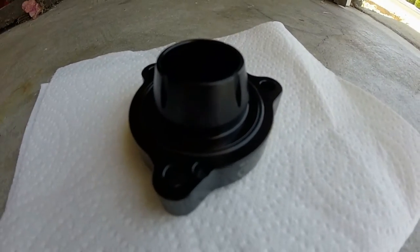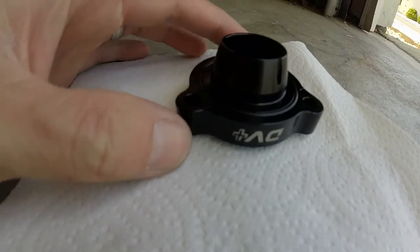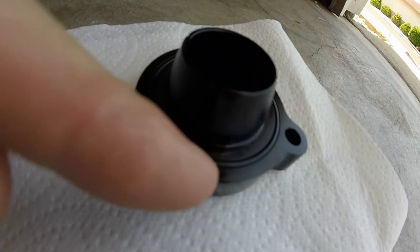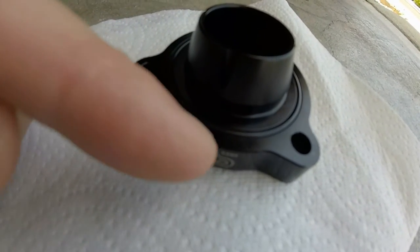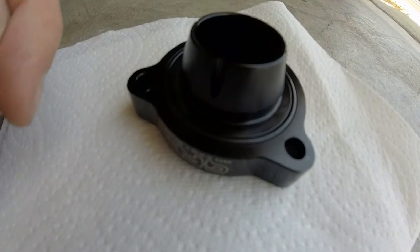Hey guys, the follow up on that squeaking noise — it was the DV Plus in my case, it's the T9351. Now there was oil on both sides of the O-ring here. You might not be able to see it with this light, but there were stains on both sides. There should not be any oil on the outside of this O-ring — it's supposed to seal in everything.